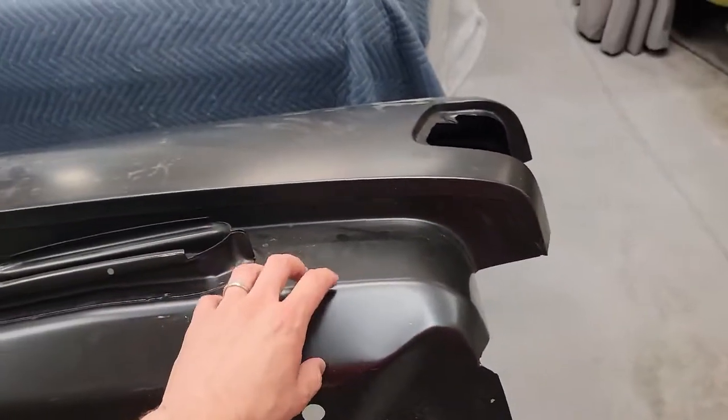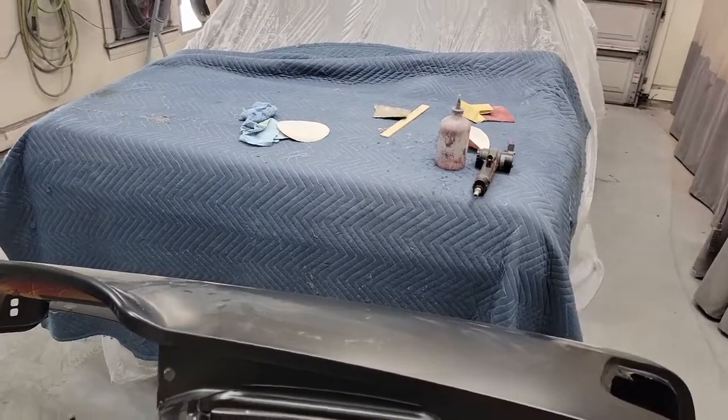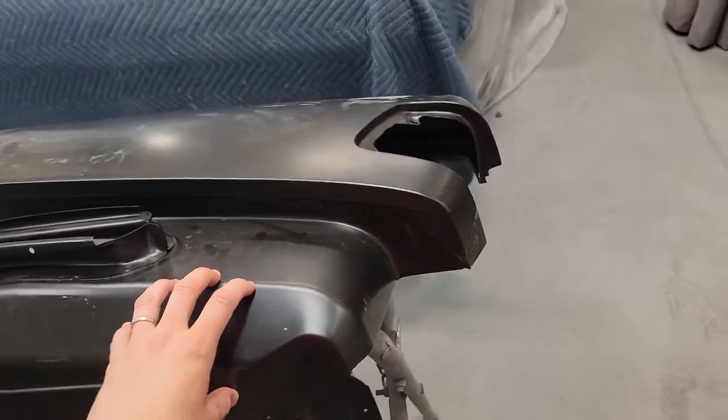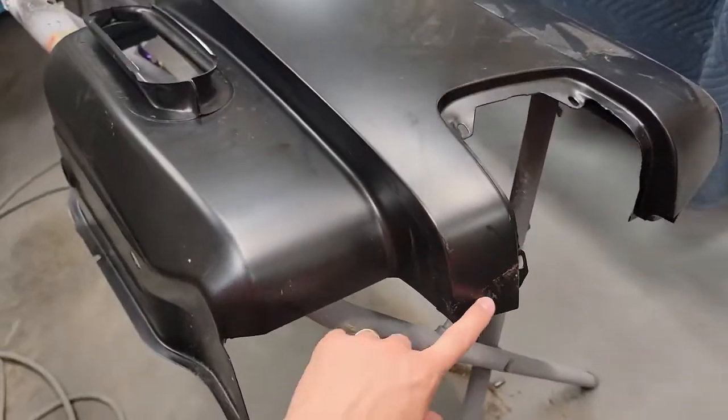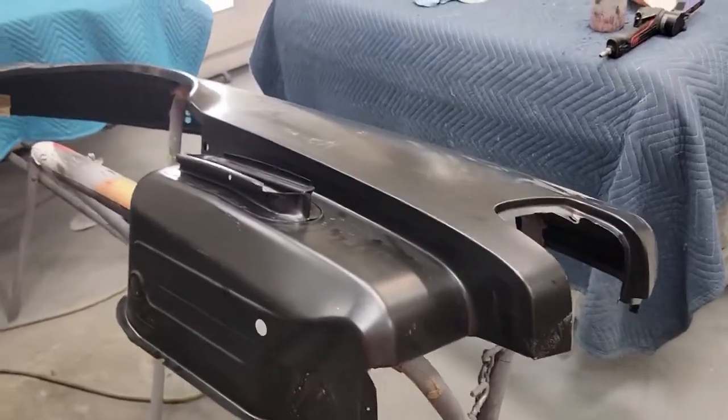I think I need about an inch of this piece and probably some of this on each side of the car, but we'll see after I get this off. I just want to get this separated so I've got these small pieces to work with and not the whole assembly. I'm going to drill from out here what I can get to and then go from inside for the rest of them and just get this off. Then I'll do the same thing to the other quarter panel, put the rear body panel in the car first, get it all welded in, and then weld this into the quarters.